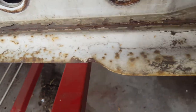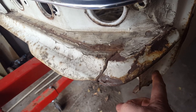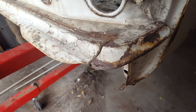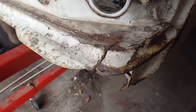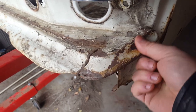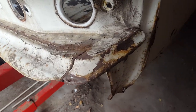Definitely somebody has been wrenching on this car before — there are a few dents and dings. Need a little bit of hammer and dolly work to get it all straightened out. When I took the bumper off, I found that this piece here had been pounded flat right against the body. On these cars, in order to take the bumper off, you actually take the end sections off. I managed to straighten it out — not too bad — but a little hammer and dolly work will get that all straightened out and looking pretty again.